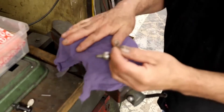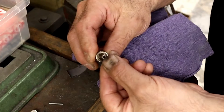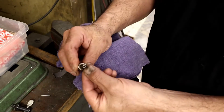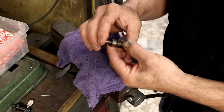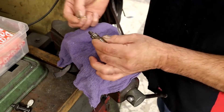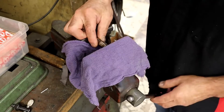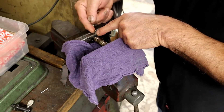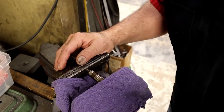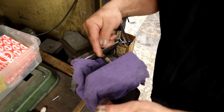Here we're at the vise, and we're going to bleed the oil out of it — oil is going to come out, so make sure you use a rag. What we don't want to do is see the end of the lifter; it has a hole in it. If you put it in here with the rag, make sure you don't shove a rag in there. If you have the ones with a hole at the end, you can use this procedure for all hydraulic lifters. Sometimes you may need to use a bolt on a lifter bucket to bleed the oil out. I'm going to aim the little hole on the side of it down. Don't go all the way down until it bottoms out — you don't want to bottom out a lifter. Just push it in — it may take two or three times.